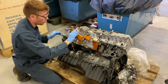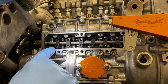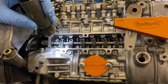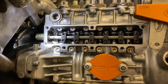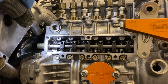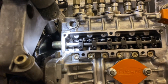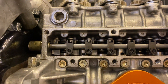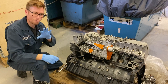The thing to know about these injector pumps — and this is a rough guide, but it's going to help you out if you're in a fix — is cylinder number one: when you see that element lift from the bottom, when the plunger lifts, have a look in this hole. We've got six pumping followers and they go on to the elements. If I rotate the engine, you see how number one is going down. We wait until it's gone all the way to the bottom, then keep turning. You see how it's still at the bottom? Keep turning — still at the bottom. Now it's starting to lift. Turn it so it lifts about two millimetres. That lifter has just lifted about two millimetres — that is start of injection.